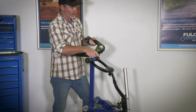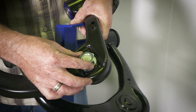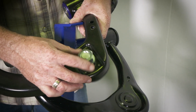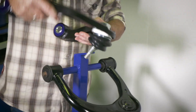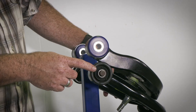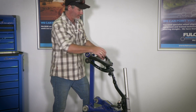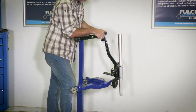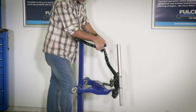And this right here is the solution: the Super Pro adjustable upper control arm. You can easily adjust the camber and caster back to where it should be by adjusting this ball joint. Look how much bigger and stronger this ball joint is on the Super Pro adjustable arm too. As an added bonus, you get polyurethane bushes as well, which are much stronger and have a far greater wear life. If you're lifting your ute, you really should fit adjustable upper control arms to get your wheel alignment back to where it should be.